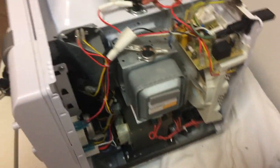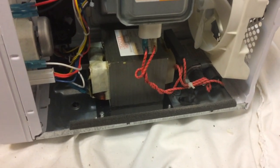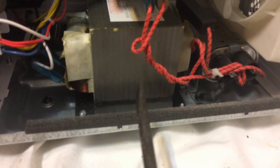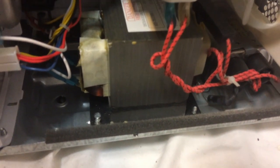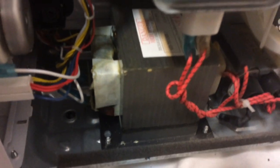So this is the inside of the microwave for the repair. I'm going to point a few of the items out. I don't think I will be able to do the repair, and I will explain why. The main thing you need to be careful about when opening a microwave is these things - both of them. They have high voltage, so they need to be discharged properly. They are capacitors. I think the main one is this one, and this is just to dissipate things. You can see this one is grounded already - the black thing touches the lid down there. I heard from the internet that they're supposed to isolate themselves, so normally unless they malfunction you shouldn't get zapped. But you can read what it says there: don't touch without discharging. Always follow those rules.